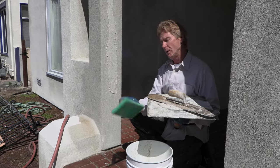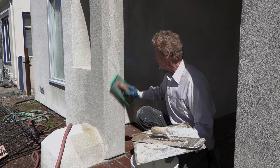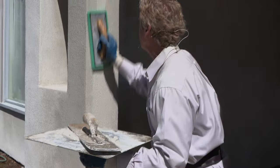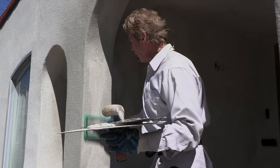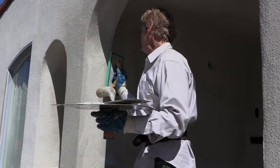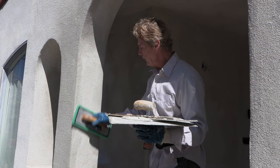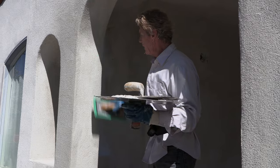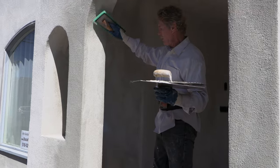What you can do on some of these color coats — like we're doing crystal white — crystal white is very forgiving. It's one color that we know from experience that is easily blended in. All the rest of the colors are way more difficult. If this was say a base 200, which is a base gray, I couldn't do this. But it is base 100, and base 100 is white, and it's crystal white too — so this one color is the one we can get away with.